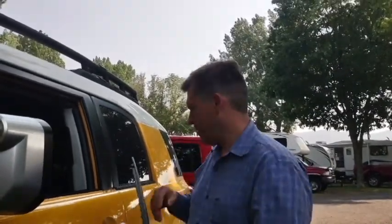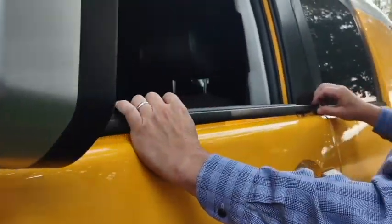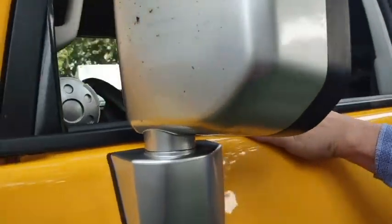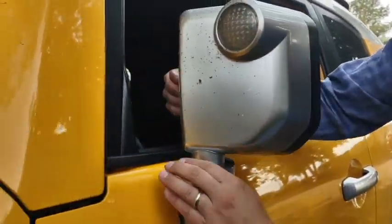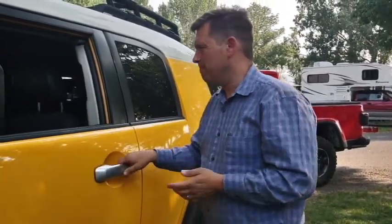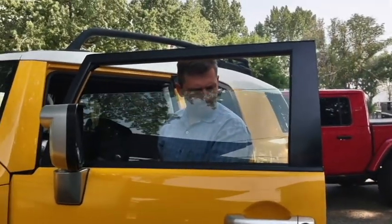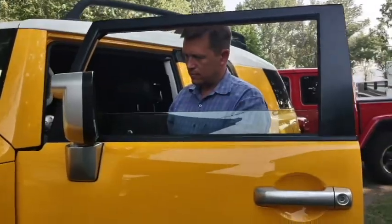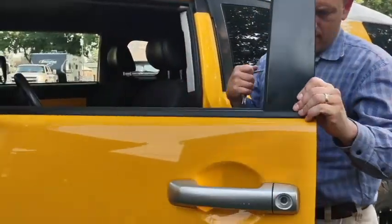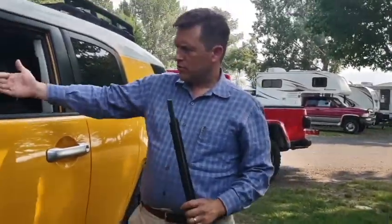So everything came out except for a little bit of that plastic clip there and a little bit of that plastic clip, and those fell down into the interior door. If I ever have to do any work on the door obviously we'll take those out. Now we just line it up and it becomes super easy from here. That plastic clip lines up there, this plastic clip lines up here in the back, and then you make sure you get it over up there and it pops in. Now the last thing to do is roll up the window. That worked beautifully — looks nice, and eliminated the weather stripping being loose and letting dirt and grime, who knows what else, get in there.